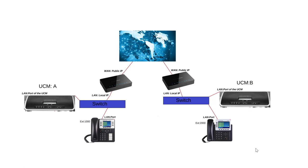By the way, all those ports can be changed for security purposes, but I do have a video on that, and if you want to see that, go ahead and click on this link in the top right hand corner, and that will show you how to do port forwarding if you haven't done that. But beyond that, you will have to make some SIP changes on the PBX to advertise your public IP and local network scheme behind your router. But beyond that, I have a whole video that will describe that for you.